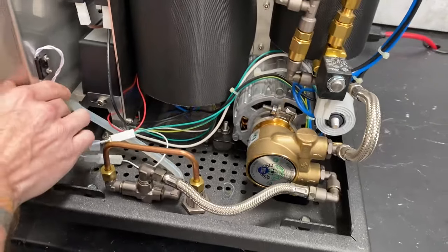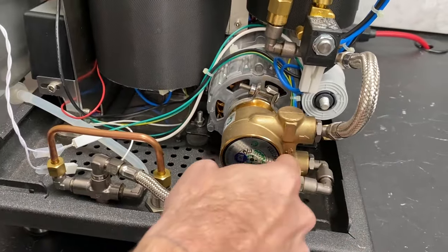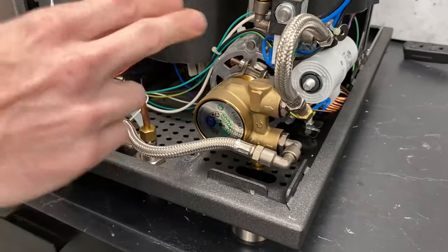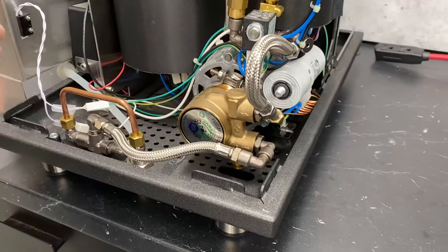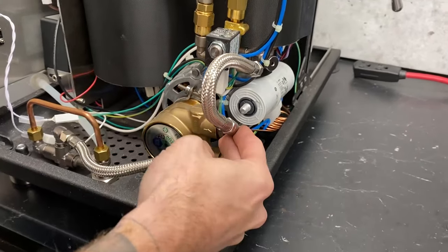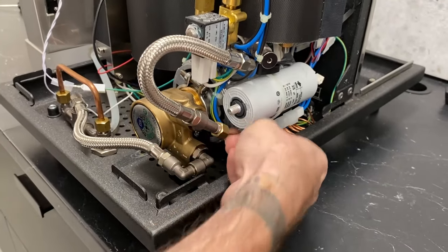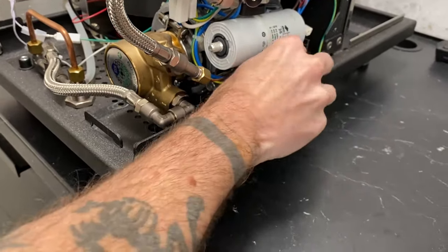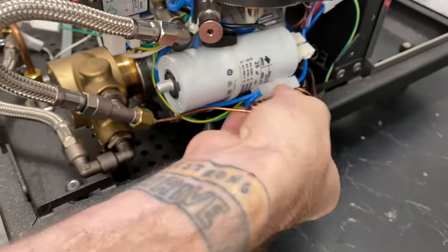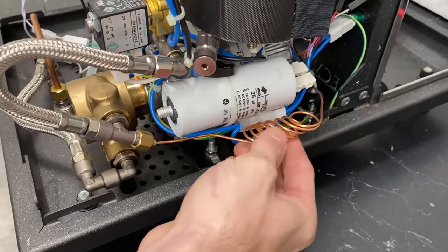Back to the hydraulics — your water is coming in from one of your two locations into your pump. This is a rotary vane pump. Inside here, there are little impellers that spin around and boost that water. It's going to come out at this T-section right here.